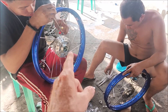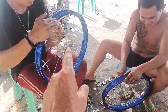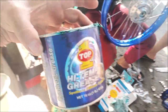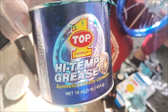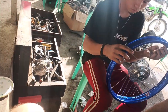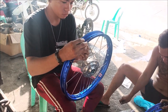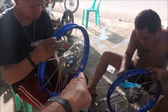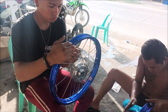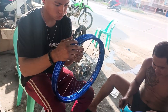I'm getting all stainless steel stuff. The hubs are aluminum but the bearing is not stainless - it's regular - and the bushing inside is regular. But I packed the inside of these hubs with marine grease, synthetic lithium marine grease, packed them solid to help keep the water out. It'll just displace it. The rims, by the way - you can see the flag on the wheel - that's the Thai flag, so they're made in Thailand.